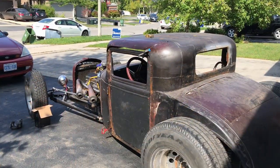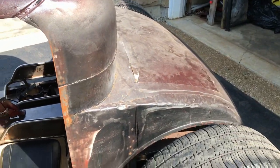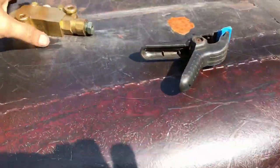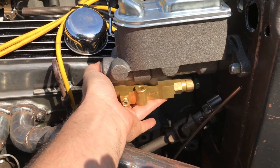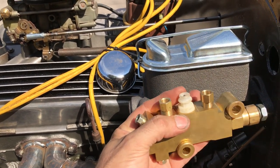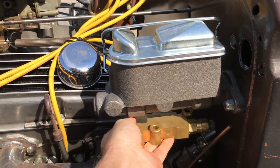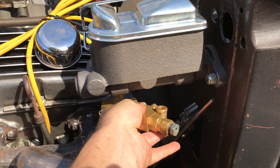We're past the halfway stage with the brake project. The back's all plumbed in, the pedals are in — gas pedal, brake pedal, both fully functioning. So all that's left — and by 'all' I mean lots left — is this combination valve. It's going to have to sit about there. This thing basically distributes the fluid to all four wheels, including the little fault switch sensor. So I need to make a bracket for under here that'll probably attach to these two bolts to keep it all nice and stiff. I also have to add the rear brake proportioning valve.